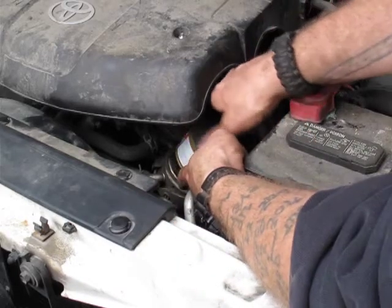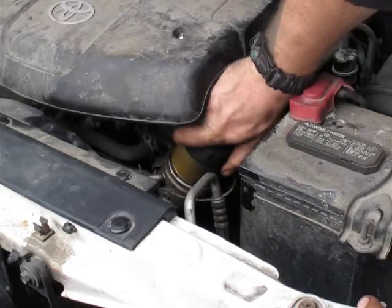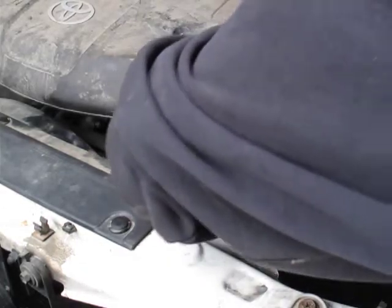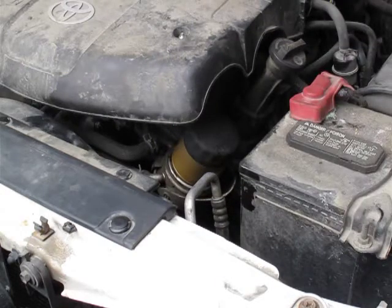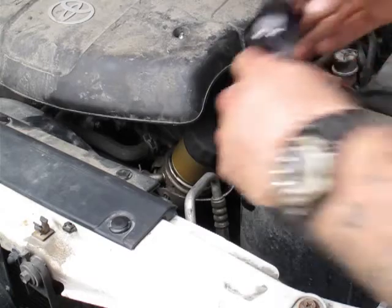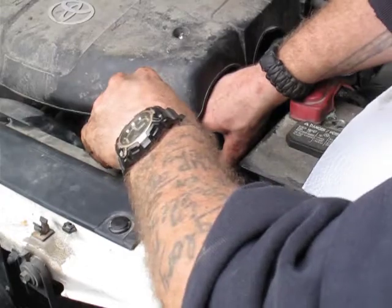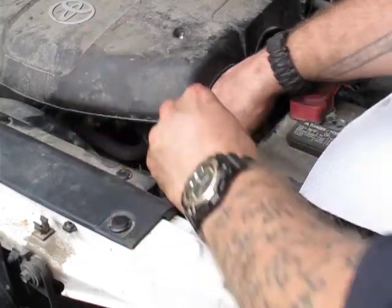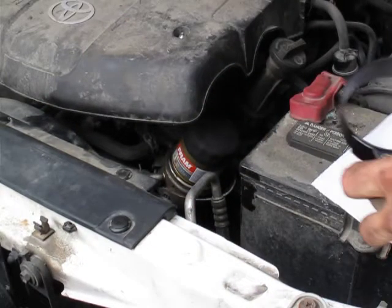The bit of oil on the gasket is just to help it create a seal when you put it on. Every mechanic buddy I've ever had help me change an oil filter always does that - so if you know what that does, clear it up in the comments for everybody watching. So we're just going to get this on here and screw it down. This doesn't have to be rocket tight - just slightly more than hand tight is all you need. Give a couple quick turns with the filter wrench and that's it. Filter is on.